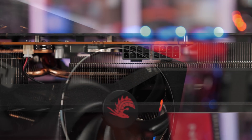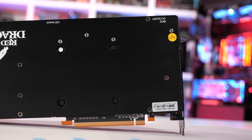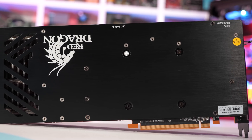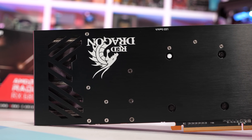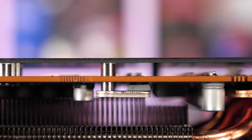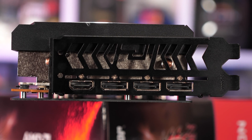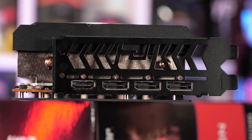You'll also find a pair of 8-pin PCI power connectors here. Moving around to the back side of the card, we find a full-length aluminum backplate featuring a few cutouts at the end that allow air to pass through. Interestingly, PowerColor has spaced the backplate quite far from the PCB — 4 millimeters in fact, about double what we normally see. This helps with airflow between the PCB and the backplate, though it means using thermal pads here to extract heat from the PCB won't really be an option. Around on the IO panel, we have a single HDMI 2.1 port along with three DisplayPort 1.4 outputs. Unlike the Fighter, which had a button for switching the BIOS on the IO panel, the Red Dragon uses the more traditional PCB switch, which you'll have to access from inside the PC case.